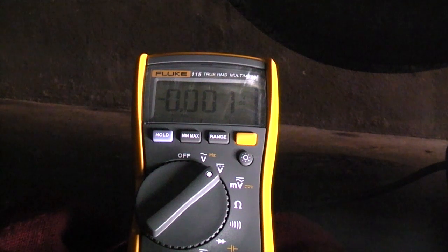Now to test the signal wire, I'm going to pull the connector off, which will remove the ground connection through the switch. And there it is — 12.03 volts. That's battery voltage. So that tells me the signal wire from the PCM to the switch is good.